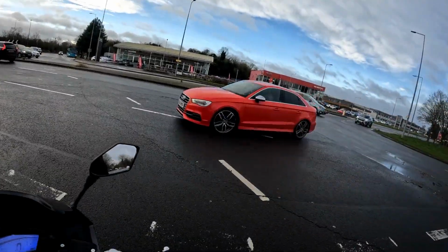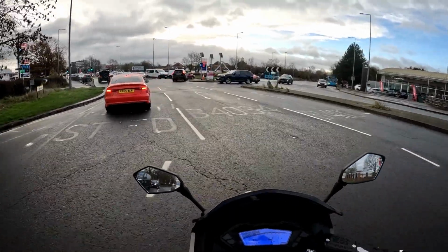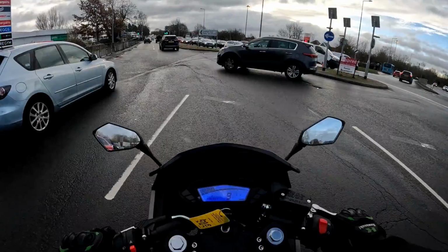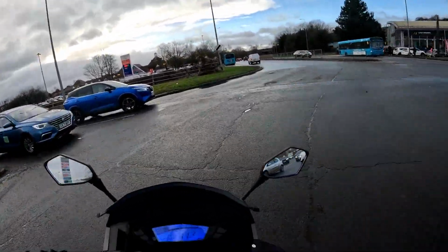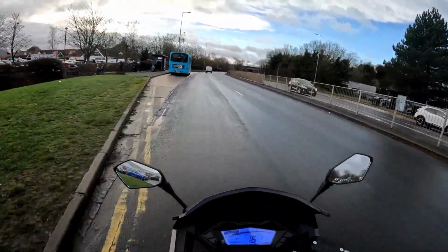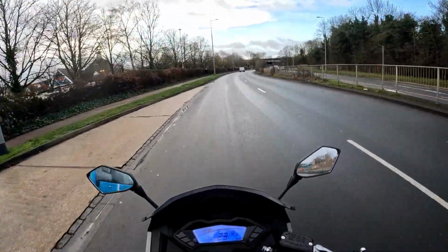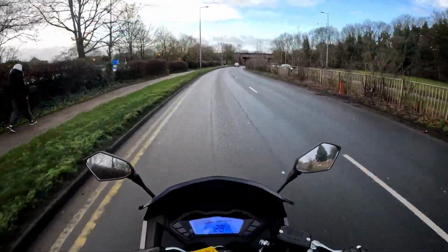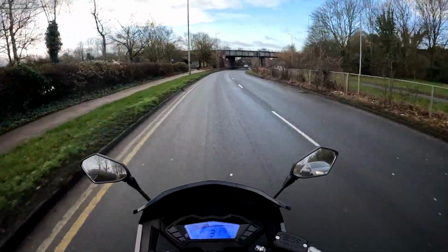You can see the window, but to top up your water, you have to take the entire side of the bike off. It's not like your car where you can lift the bonnet and just top up your coolant. So do keep an eye on those water levels, peoples. Low levels will lead to issues, and it's not just the Chinese bikes, it's your main brand bikes as well, your Hondas, Yamahas, Suzukis. Keep an eye on the water levels, because a 125 engine does get very warm.